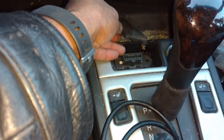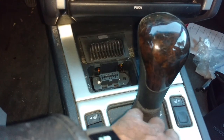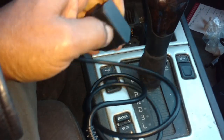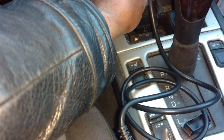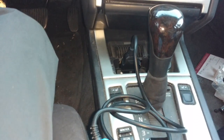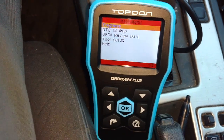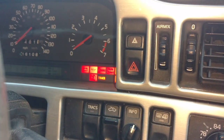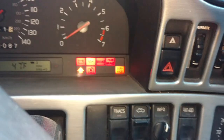My car is a '95 and it still has one. A lot of vehicles didn't have this until '96, because that's when the U.S. government made it necessary. You remove the dust cover from it and plug it in. A lot of cars have this port under the knee portion of their dash somewhere, so if you get on your knees and look down there, you'll find the port. Some cars have it in the armrest — it's usually somewhere close to the driver. Once you have it plugged up, turn your vehicle to run, meaning turn it on but don't start the car. It's not necessary to start the car to use this.